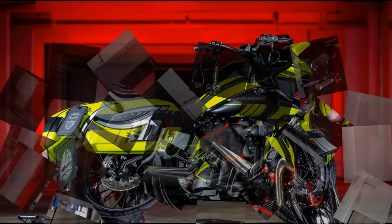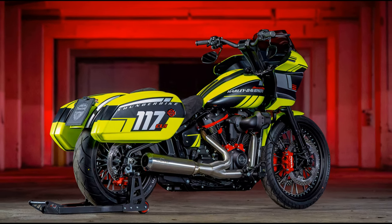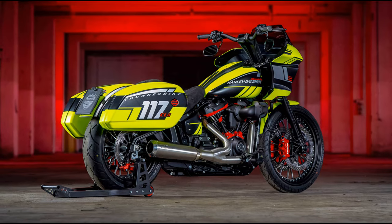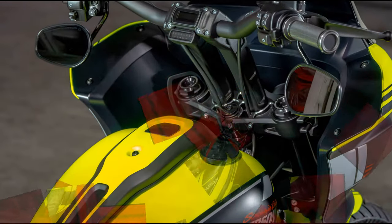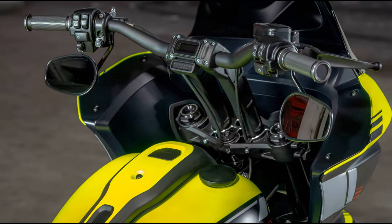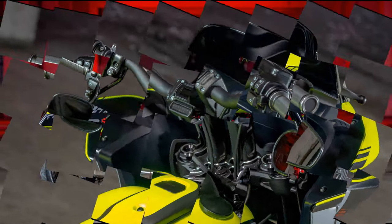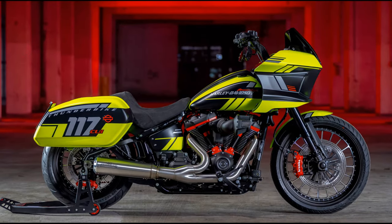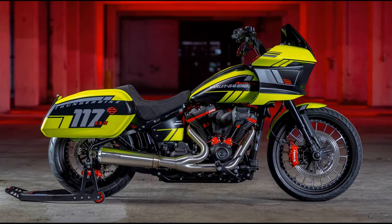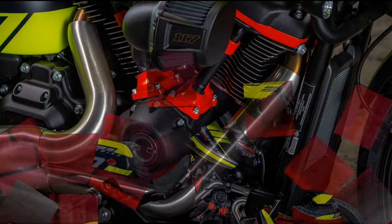Instead of an ape hanger, we have a brand new club-style handlebar, which is also called club. The club is butted, making it narrower at the grips and therefore lighter. The production with simultaneous cranking is quite complicated, but we can do it. It has only a slight offset and sits on 9-inch risers, which are hollow so that cables can be routed through them, and to save weight. All this makes our bike more maneuverable. And just before the bend, you can go for it.